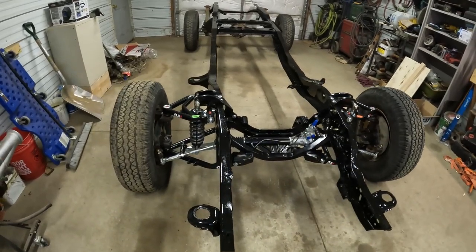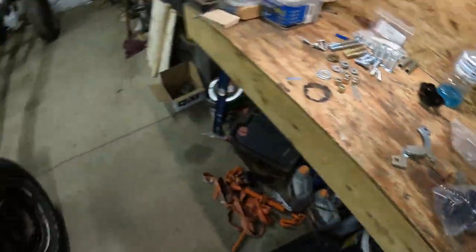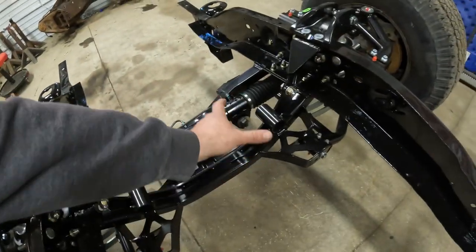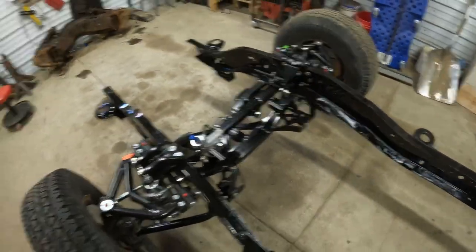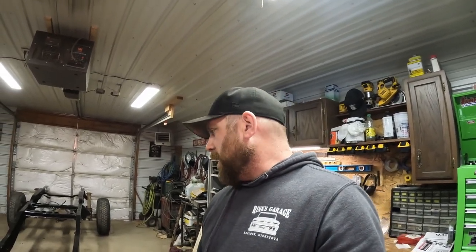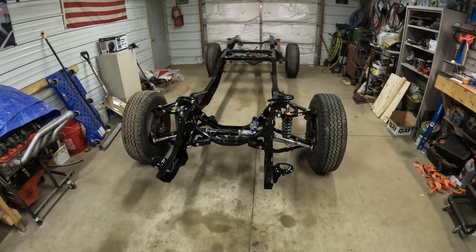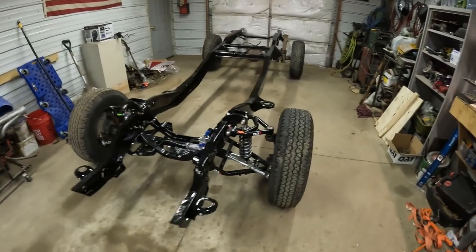It's going to be a pretty nice ride, I think. It does come with some extra stuff — we got tools for adjusting the shocks, and then some motor mount bushings. It's got a tube on each side that will slide in and you can build your own motor mount, or I believe you can buy them from QA1 — big block, small block, LS even. I might look into that. It was about six to eight hours of actual working time. It was a little easier since I didn't have the cab and fenders on it, but it could definitely be done with all that stuff on it. Next on the agenda is probably getting the cab buttoned up and set on there so we can get to mounting the motor and tranny.